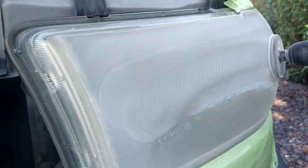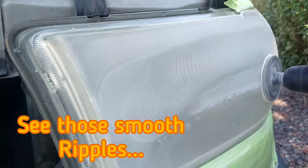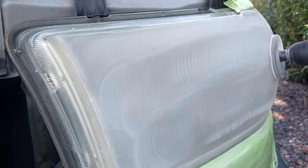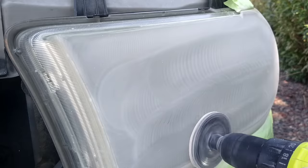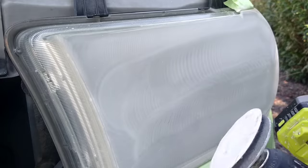And any true headlight restoration must, especially in my opinion if you're selling a product, have a sealant to it, a UV sealant. You've got to have a UV sealant. If you just put a regular sealant on it, it's going to go bad underneath the sealant very fast.